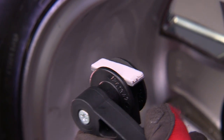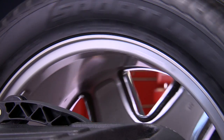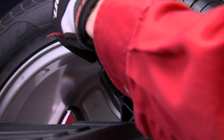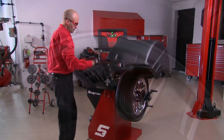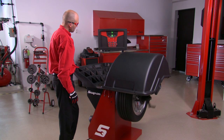Use the safe arm to place the tape weights in exact locations. Be sure to clean the surface of the wheel prior to applying weights. When the correct position is located, the machine will sound an audible beep to indicate proper positioning. Once the weights are placed on the rim, lower the hood to complete a check spin to determine if the display shows zero weight required.